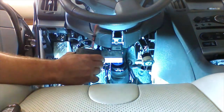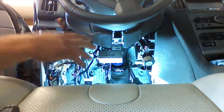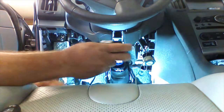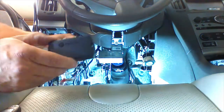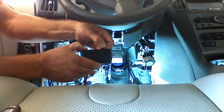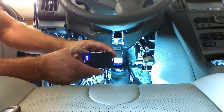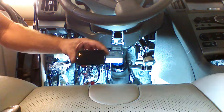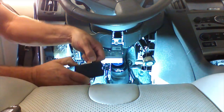Our units come completely plugged in so you know where every plug goes. At this point, unplug all the plugs from the device. There's a program button located at the top — hold it down while you plug in the four-pin plug or the data plug. The lights on the device are going to begin to cycle. We want to release on a solid yellow. If we miss it, the device will cycle back around and we can release on solid yellow. If we make a mistake, we can unplug the device and redo the procedure.